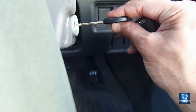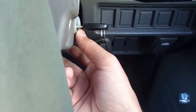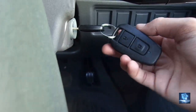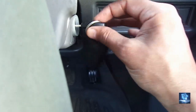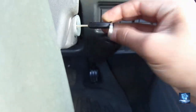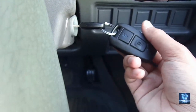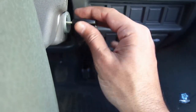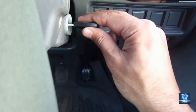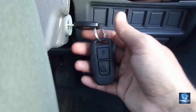First of all, I will tell you how the immobilizer works. The immobilizer basically has a transponder signal for the ignition system. Your security chip resides in the remote. When you insert the original key, the transponder scans for the original key. When the original key sends the correct code, the immobilizer allows the ignition system to function and your car starts.